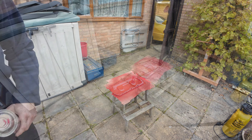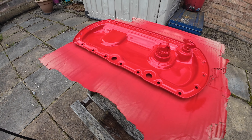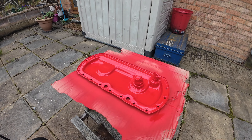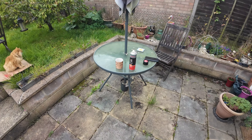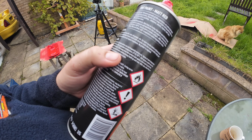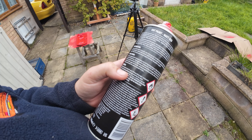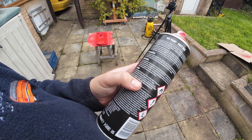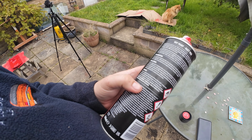There we are. Now it looks bright red at the moment, but it will go a little bit darker because it's going to go matte. I think that's good coverage — that's what it wanted. One sort of thick coat on there, you don't have to put any more coats of this stuff on. And then it says here on the can: allow it to dry for 10 hours. Curing can be carried out by the operating heat generated by the engine, or you can bake it in the oven, which I have done before with some brake calipers — you build the temperature up gradually.